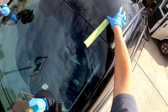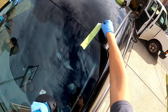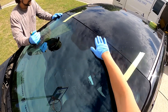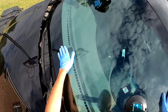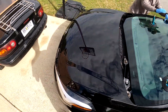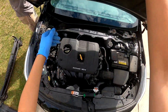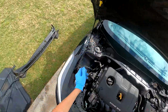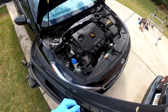Set your tape. For those setting on the driver's side, make sure your VIN number lines up properly — the VIN number is the best way to get alignment — or you will have a customer complaint and you cannot just push out the windshield and reset it without a lot of cleaning. When decking the glass, press against where the dash meets the black ceramic frit band — that's the best portion to apply pressure. Putting pressure lower toward the end of the glass can cause the glass to crack, so you're just barely decking it.